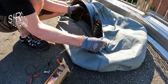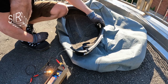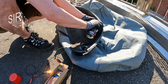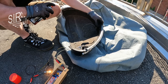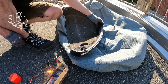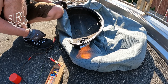It can rotate within the bushing, and this is part of the electrical path. Well, it seems to provide a decent electrical connection. It is rotating a bit rough though. To improve that, I will apply some oil for lubrication and conservation. Now it moves smoother. When I now connect 12 volts to the corresponding contacts of the lamp, it works.